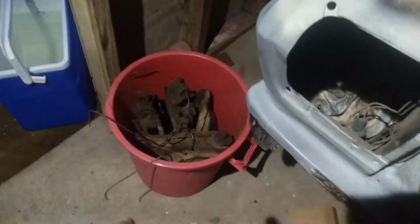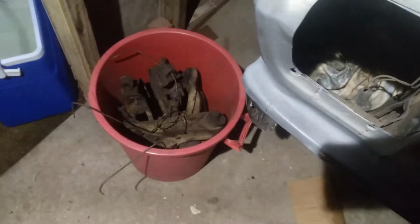So I'm going to mix the solution up now and dump the water in here, then top it up if I need to, till it's covering the parts. I've got my piece of sacrificial steel, which is a bit of heavy steel wire, in there. Before I hook the electricity up, I'll make sure they're not touching, and we'll crank it up and see what happens, and hopefully we get a decent result. I'll carry on and get this all sorted out, hook it up, and come back in an hour or so once I've had some tea, and we'll see what it looks like. Alrighty, cheers.